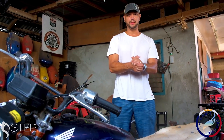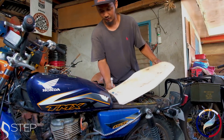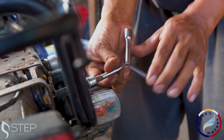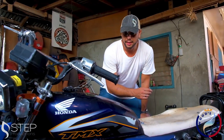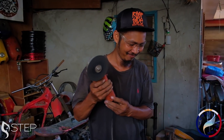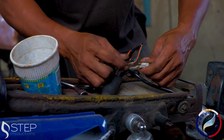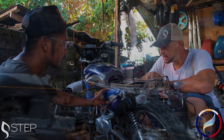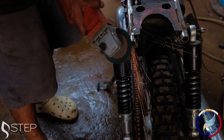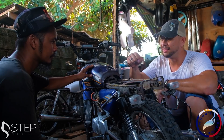So exciting day. This is the first part of preparing our little Honda TMX to transform it. What we're going to do today is we're going to get the seat cut and we're going to start to shape the actual pan for where the seat is going to go. It may sound small, but it's a big part of the full aesthetic of this build and it's a critical element to get the shape done right so that we can build the rest. We're going to remove this whole back end off, and this top layer bracket that's been added is going to be taken off as well in preparation for what's going to be a really beefy looking motor and seat. We're also looking to extend the swing arm by another three inches.